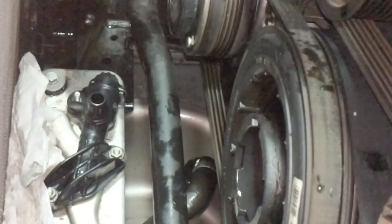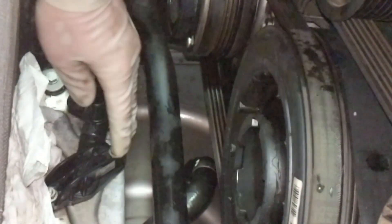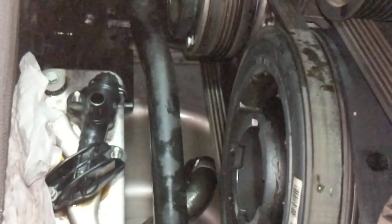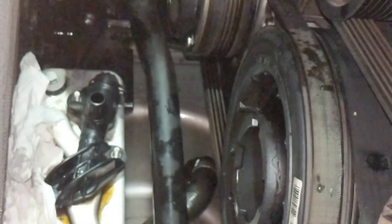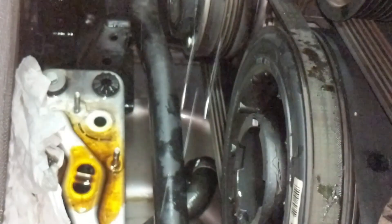The one side doesn't seem to be running out anymore, so I start loosening these up. These are 10 millimeter nuts because these are studs. Here comes the fluid — it's running out relatively slow, hopefully it stays going slow so I can do a quick swap. Oh god, coolant's coming out again. I want to take this off slowly so I can check the mating surfaces and make sure everything is good. Oh shit — full and rushing out the top.